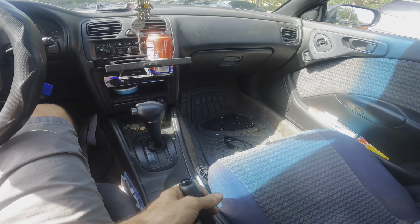All right, let's just go ahead and start from the rear end. Let's see what the deal is here. I see some fluid already. Oh no. Okay, it appears that this line right here leaks, and there's a bolt in it. That's the line coming from the master, which has a bolt in it, probably to plug off this line right here that goes to the right rear wheel that is leaking.